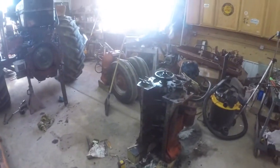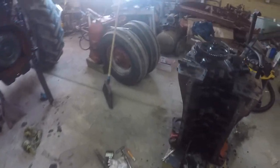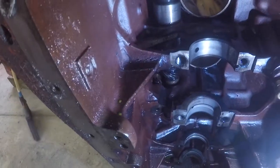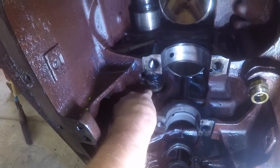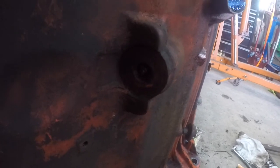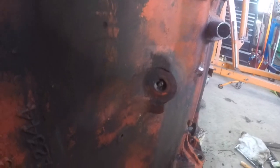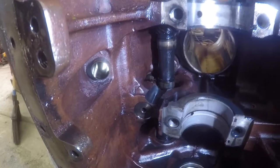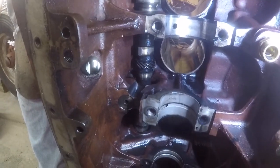We're going to save all these spare parts. We're trying to get the cam out now but we can't figure out how to get the tachometer drive out — which is a little bit of a puzzle. I'm not finding it in the book either. I've been tugging on this cam for like a half hour and it keeps hitting that brass tack drive there. Maybe it all comes out through the top. You can't get the cam out without getting that out, and the book doesn't say how to take this out. So that tack drive gear has got to come out — we've got to figure that one out.